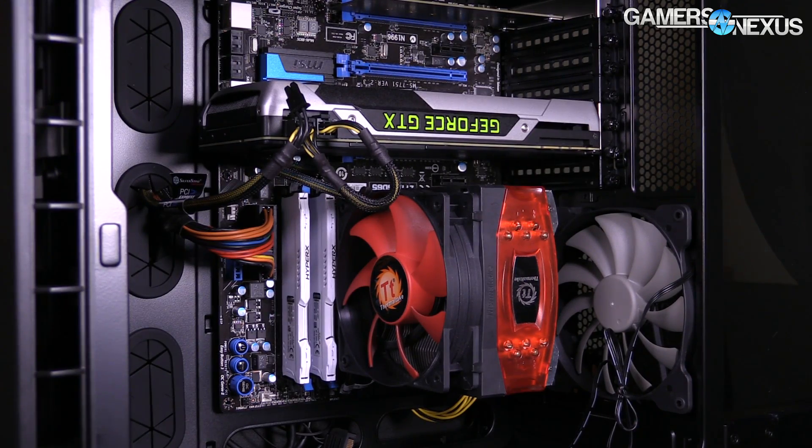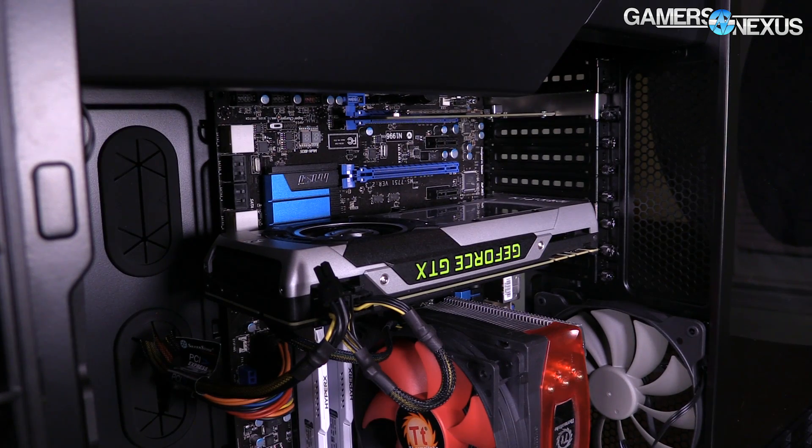When torquing down your CPU cooler, make sure you don't over-torque your screws anywhere on your computer. These screws do not need to be gorilla tight — I'd like to think of it as monkey tight. Just go until they stop and that should be plenty. You're not having tons of vibration, so you don't have to worry about things falling out. The CPU cooler especially — if you over-torque those screws, you can actually bend the board or damage the CPU. That's what the recent Skylake CPU bending issue was about.